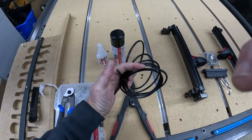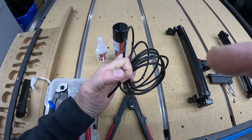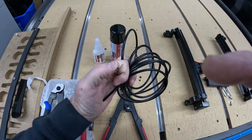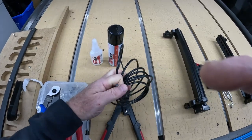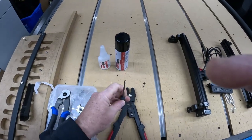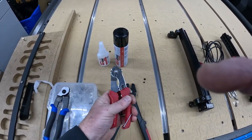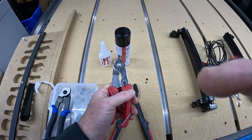When you cut your cable housing it sometimes collapses. You'll need to open up the end — inside the block housing there's a stainless steel sleeve as well as a plastic sleeve, and you'll need to open that up to get your cable through. You can use some type of pick; I've used a thumbtack in the past. They also have bicycle pliers with a neat little tool on the end that opens it up.